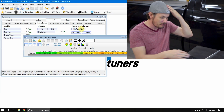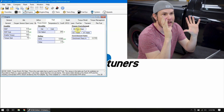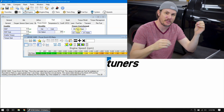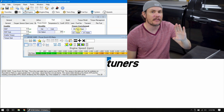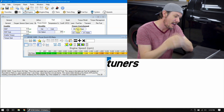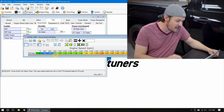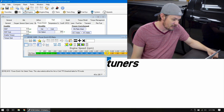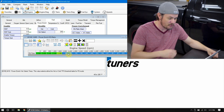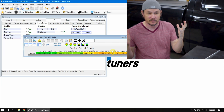This is a multiplier, and it has information that tells you how the multipliers work. If you think about your fueling goals — you're at 14.7 AFR or 1.0 lambda, and less than that is rich — and you're trying to reach 0.85 lambda, the cool thing about lambda is that with it being 1.0, if you're trying to reach 0.85, you know you need 15% more fuel. So if you have a goal of 1.15, which we basically have in this table down the low end, that puts you at 0.85 lambda. Then as you can see, towards the top end it gets richer — you're looking at 30% additional fuel. You can take the 1 off and just look at what's past the decimal — that's the additional fuel percentage.